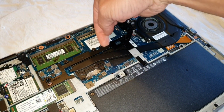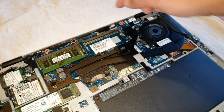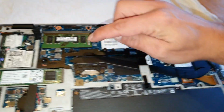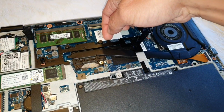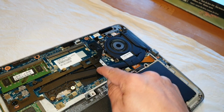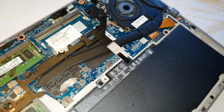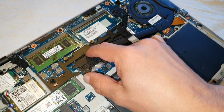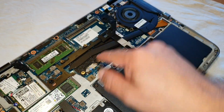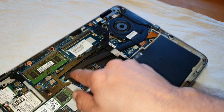This is just a small piece of cheap aluminum, like you can see. It's not really necessary. You can do a nice cut here, cut it here and cut it there, and then you just take this stuff out. You will not need it. Then you go around and do the last cut, one cut here and one cut here, and then you're able to take these 4 screws out, and then you can take all the pipeline out, the fan, and of course it will be very easy for you to change the thermal paste.